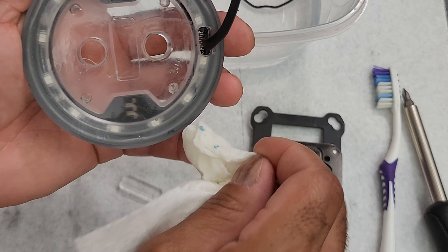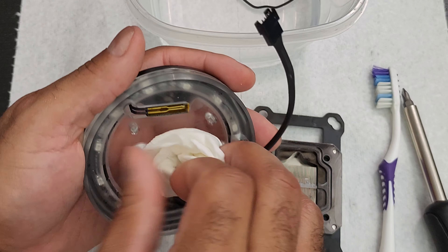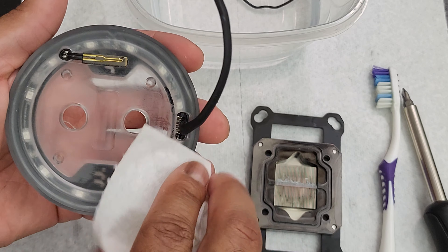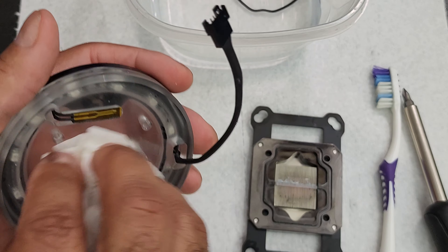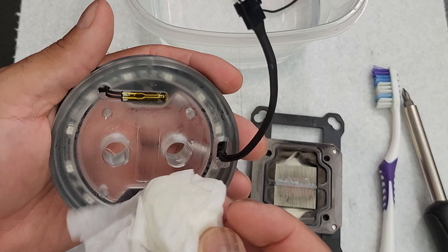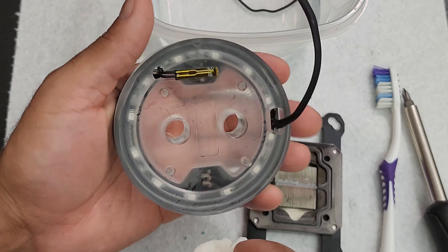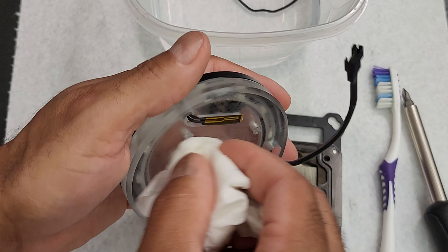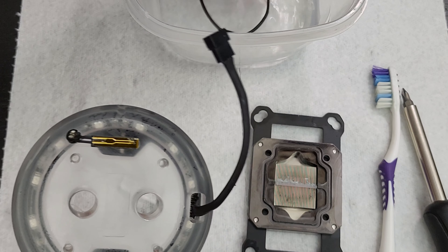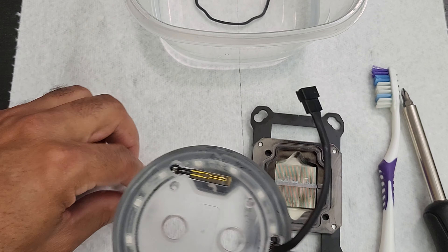I'm getting the rest of this old gunk off - you want to make it look nice and clean. This is see-through, so you don't want to put alcohol on it because alcohol and water cooling don't really mix. There are a lot of acrylic components and alcohol can actually crack acrylic and give you a really bad day. Distilled water is the way to go because this is an electronic part, and distilled water will be perfectly fine since it's non-conductive - as long as the distilled water is clean. This distilled water is a little dirty from the older fluid in the o-ring, but that older fluid was also non-conductive, though you still want to minimize exposure.